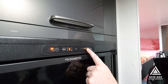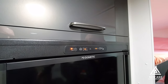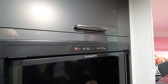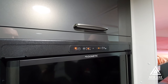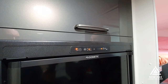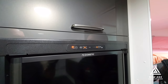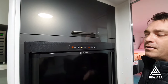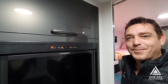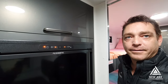We've also got a setting here with our temperature. The trick with three-way fridges is that today it's about 20 degrees outside, reasonably cool, so we don't need this on higher than the middle setting. It's only above 30 to 35 degrees that we start to move this up — otherwise you will end up with some freezing in the actual fridge component. Most of the time, us Victorians would have it on number three. Up in Queensland, you'd probably have it set to one of the highest settings for the majority.